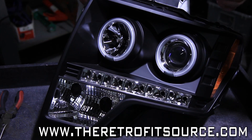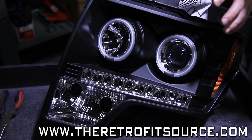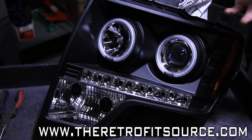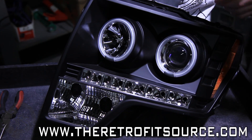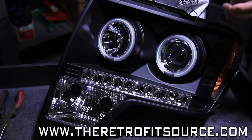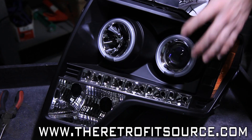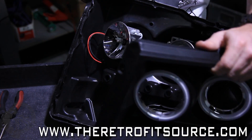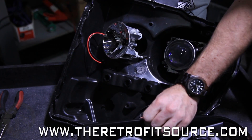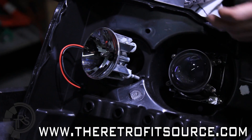So if you value your headlights for more than just looks and actually care about seeing at night, you're going to want to change that projector out with something that actually makes light on the ground. We've developed a kit that lets you replace the original projector using our Morimoto H1 6.0 Bi-Xenon projector. This headlight is still mostly assembled — if you remove the trim piece, you can see the stock projector attached to three mounts: two adjusters and one ball joint.